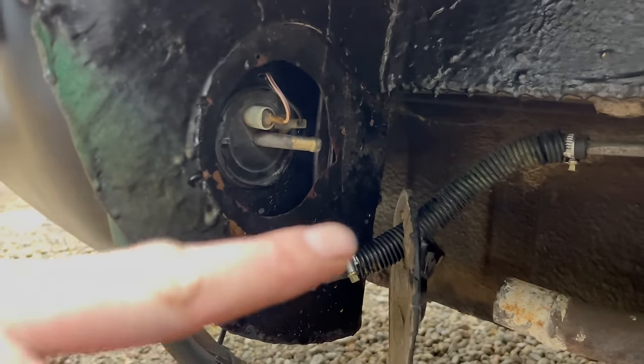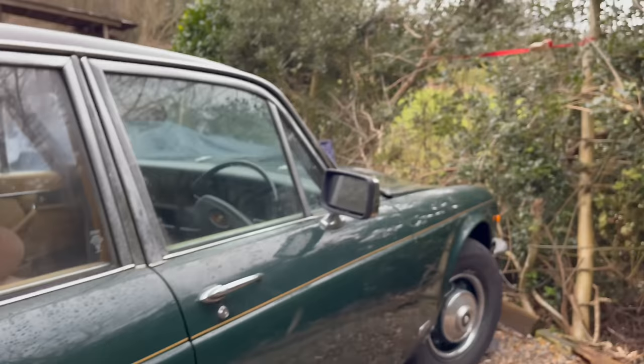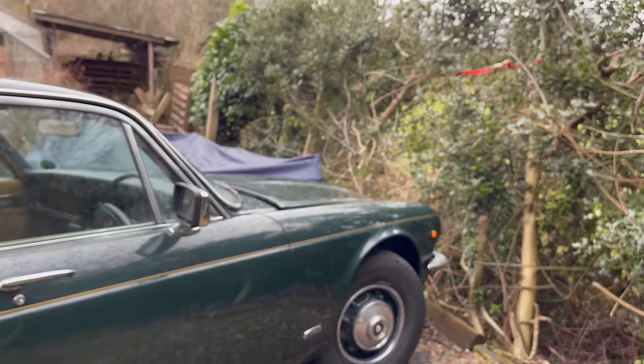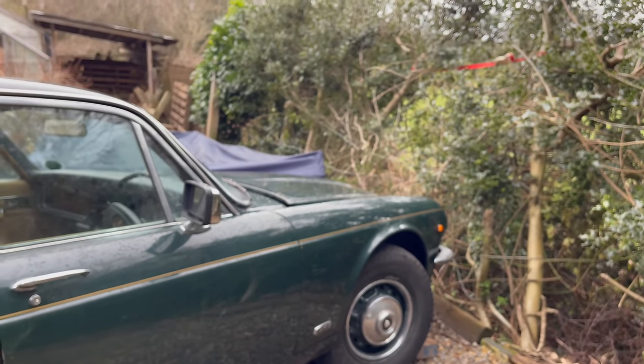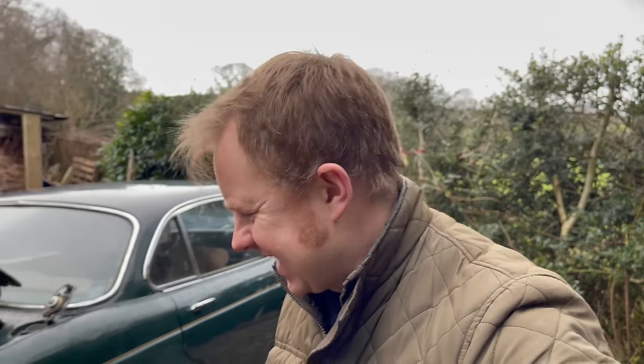I'm just going to blow the air line through the pipe and check the front to see if there's anything that comes out the front of that pipe, just to make sure it's nice and clear. And then I think we'll connect the pipe, set the pump away, and just run the fuel through to the front, just to make sure it's running through. And then connect it back up and maybe give it a try and see if it'll start.